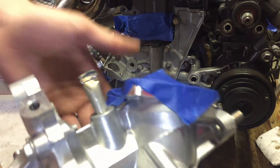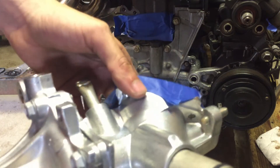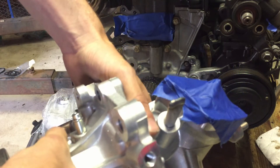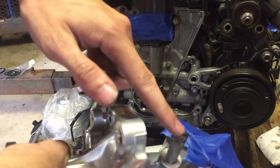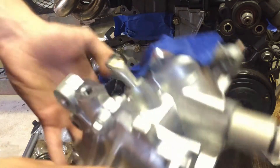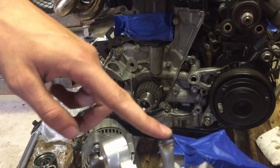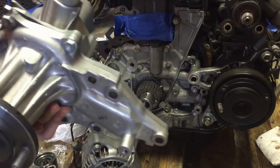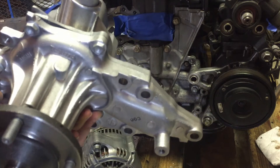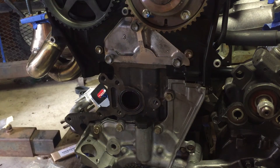It's nice to have the inlet for the water pump angled away from the exhaust manifold. The last thing to modify on the water pump before reinstalling — if you're going single turbo — is that this little nipple that angles down to the side needs to be crimped off and welded shut. It will let water out if you don't get that welded. With that done, we can reinstall it along with all the timing belt stuff. First thing is to take off the old o-ring, replace it with the one that came with the new water pump, and clean up the mating surface to the block.